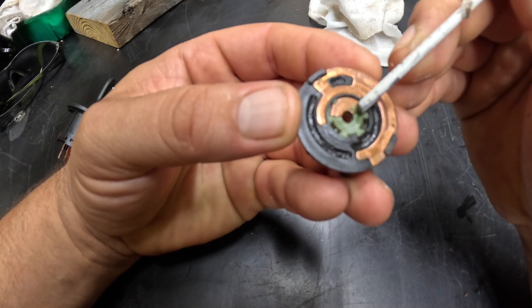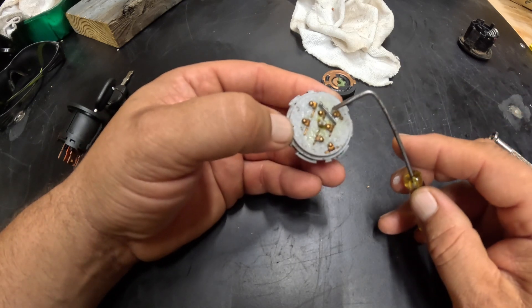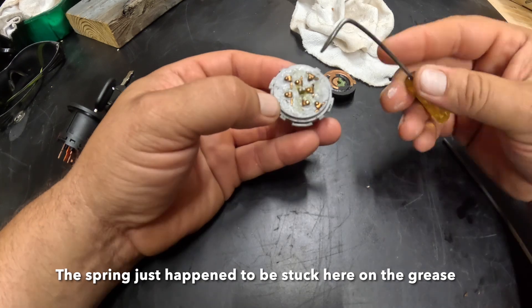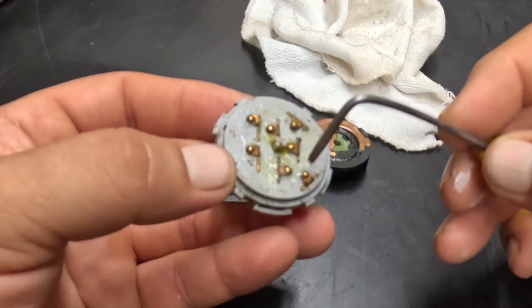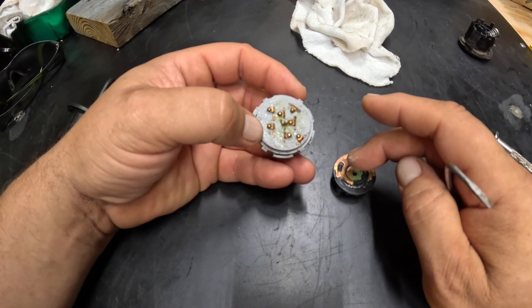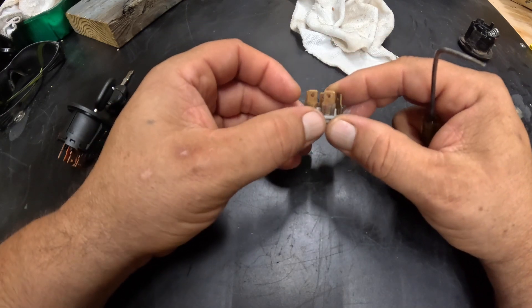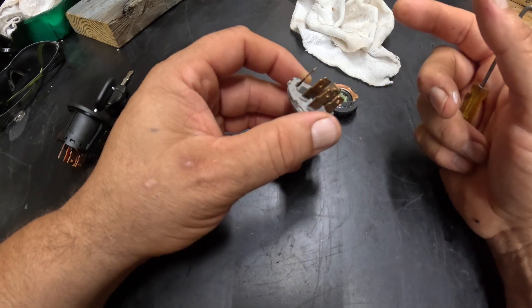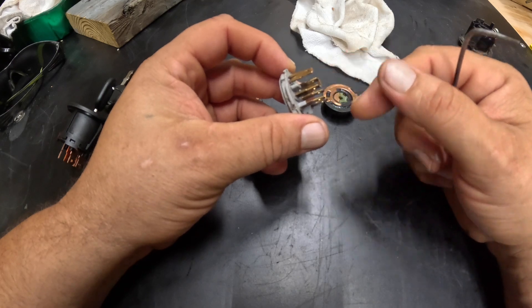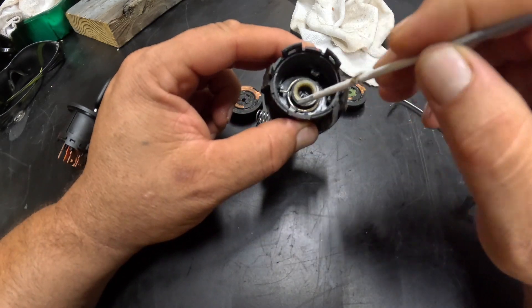You can see where the plastic is vulcanized, locking the horseshoe piece in. There are three small springs inside — when you disassemble it, make sure you don't lose those little springs. Also look for a lot of dirt and grime in here; clean it up and put some new grease on it. You don't really need grease on the outer barrel, but you do need grease on this inner part. Make sure you've got grease there. Also look at the terminals for corrosion — check the female portion of the wire loom connector as well and clean those contacts with a cleaner. You can also use a wire brush on them, and clean down inside near the big spring.